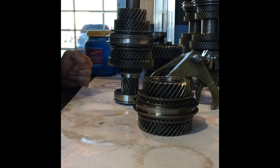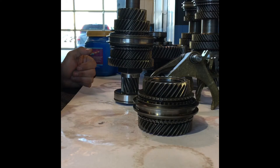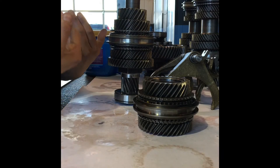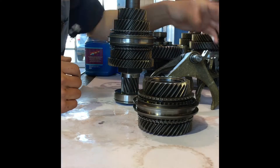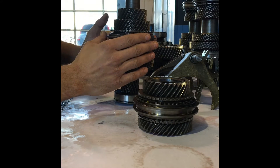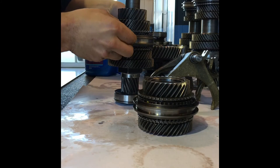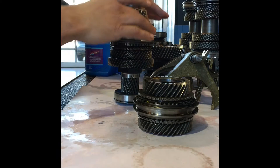My eyes are just as good as comparing to something in newer condition, as long as I know what bad condition looks like. If your synchronizer or fork was bent I won't necessarily be able to tell, but I'll know for sure on the tab if my fork is worn out or if it's been through some hard pressure shifting. Most of the time when you have a bad third gear synchronizer it pops out — you'll come halfway up into gear engagement and then it'll pop back into place on its own.